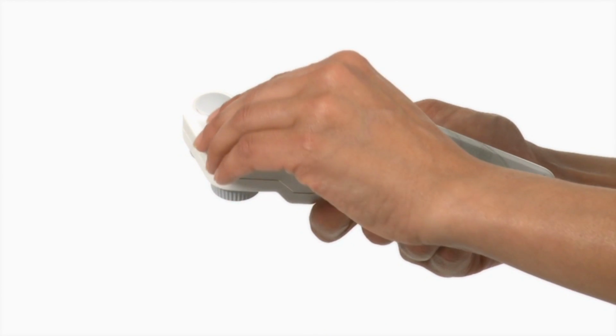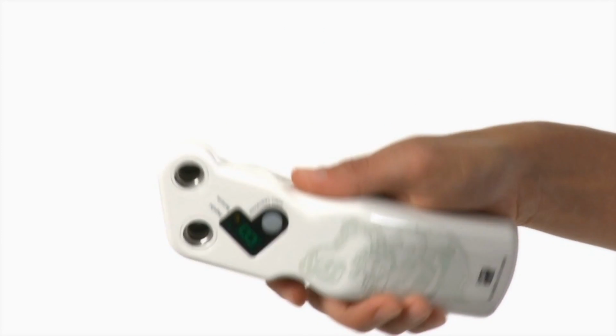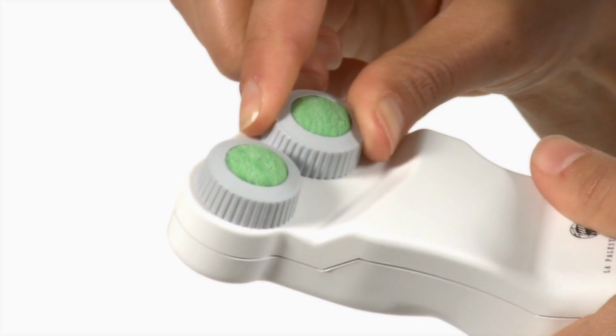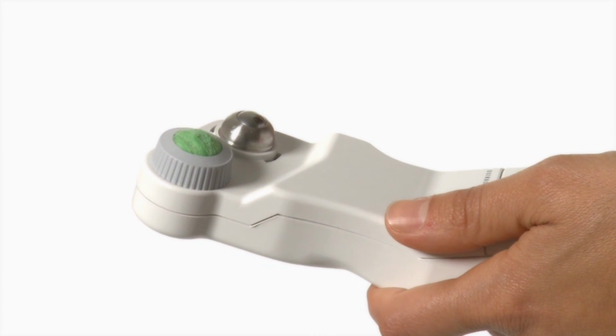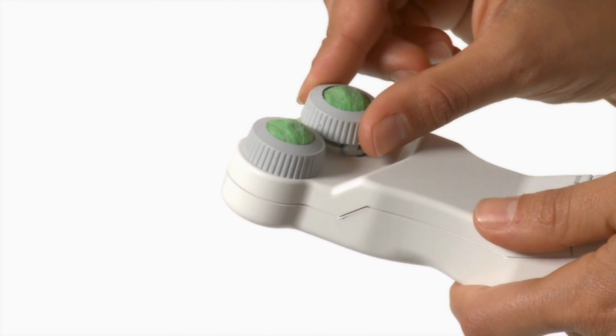Switch the appliance off and empty any remaining water out of the tanks. Turn the ring nut clockwise by a few millimeters and take it out of its position without forcing rotation or bending its attachments. Reposition the sponges and turn the ring nut anti-clockwise to lock it.